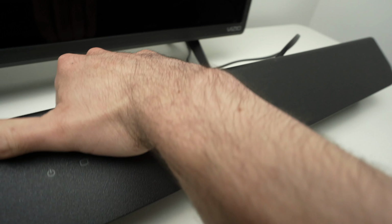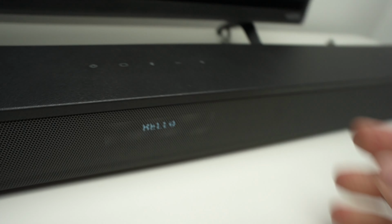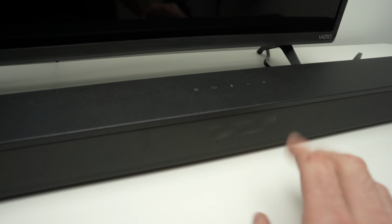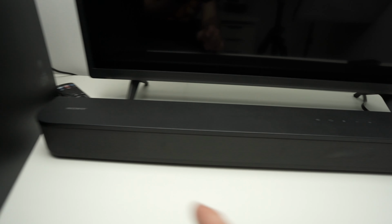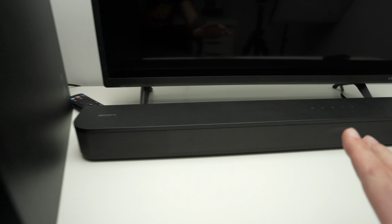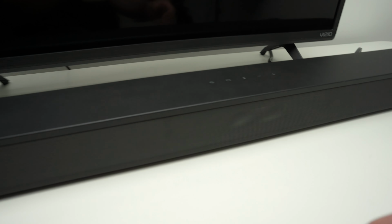Usually after you connect it back, the soundbar should power on by itself. Check the screen, it says hello, please wait. And this is about it. Your Sony soundbar should be finally factory reset. And if you had trouble connecting it to its subwoofer, this should fix it by itself, and many other problems.